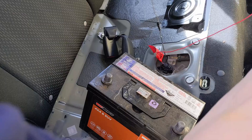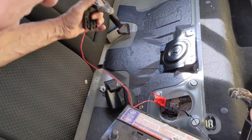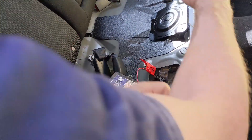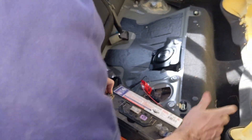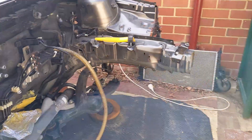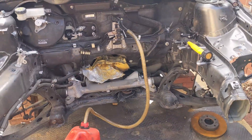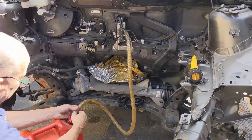So anyway, with that harness, you can quite clearly see there's my harness and here are my battery connectors. If I put the negative on battery negative and positive on battery positive, let's go back round to the engine bay and have a look at what's happening over there, because now that fuel pump is pumping. Okay, so you can see there, you can see in the line — it is pumping.